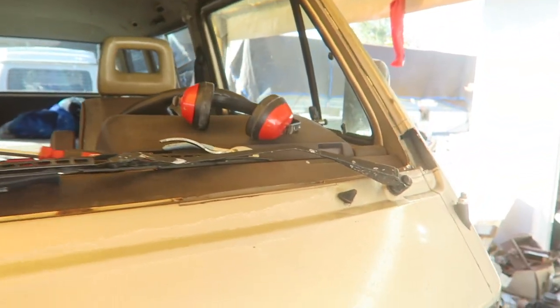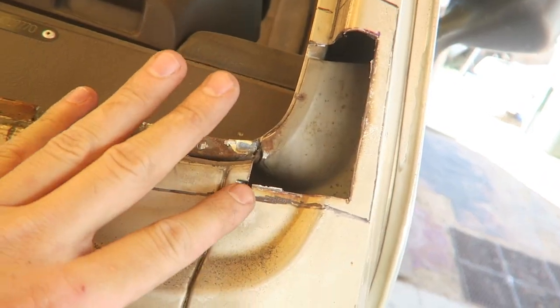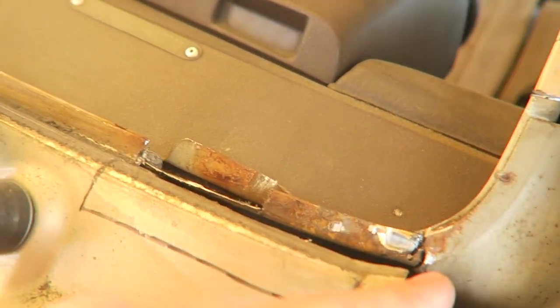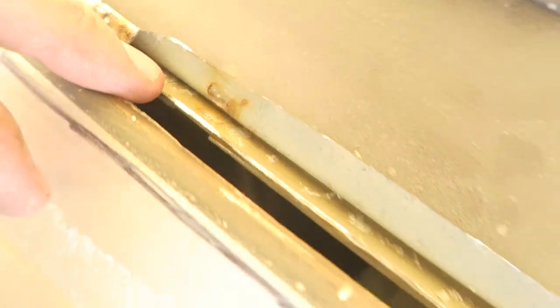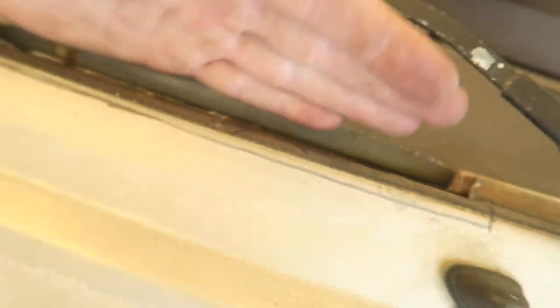About $20 in Dremel blades later, everything is all cut out. It's not prepped yet. I kind of farmed it a little bit right there, but I can fix that. I've got to clean this all up and get it weld ready. All the structural stuff is good. I know my buddy Adam doesn't care, and it's better than spending another day and a half trying to pull this dash. The dashboard is metal and he has a cover for it anyway. I just folded it up so I could get down to good metal. I cut out all the rusty stuff. I'll still have some room to get in there, and when it's all set and done I just fold this back down. There are a couple screws that already go in — see the holes right there — so it'll sit flush again. I'm pretty much ready to go.